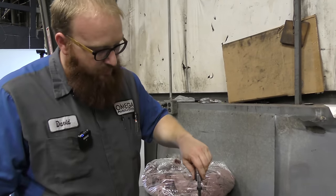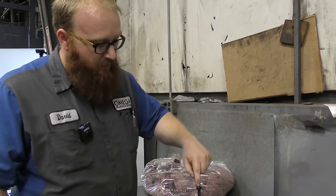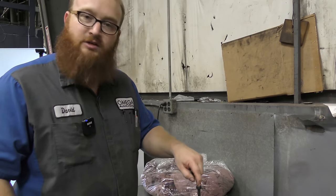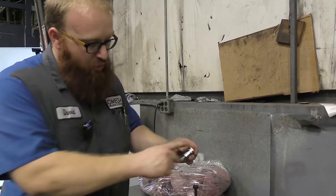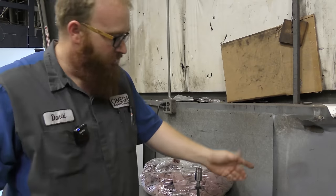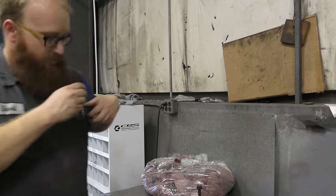These triple squares are notorious — especially head bolts. Toyota head bolts, Mercedes head bolts are these triple squares. They can be filled with gunk and grime from engine oil, metallic slime. Your tool won't go all the way to full depth. You've got to clean those out and blow them out with a little compressed air. The moral of the story: make sure your tool can get fully seated. That's tip number three.